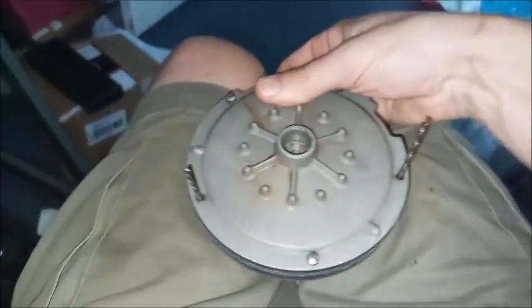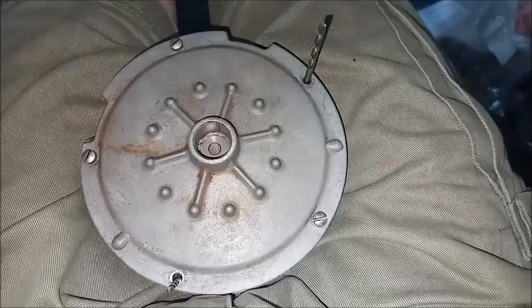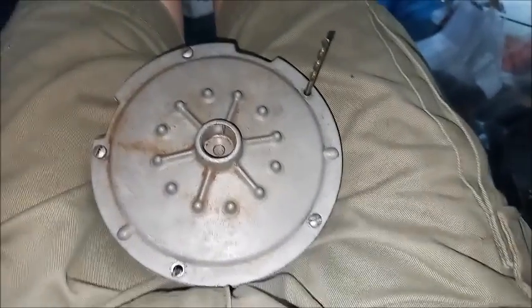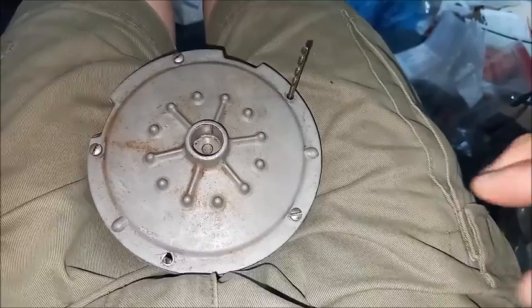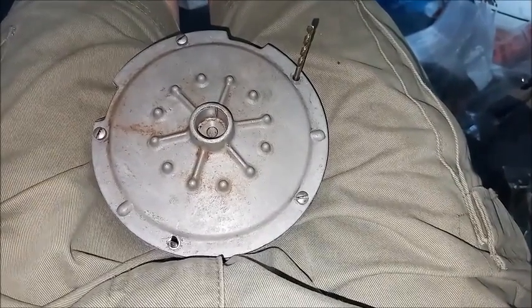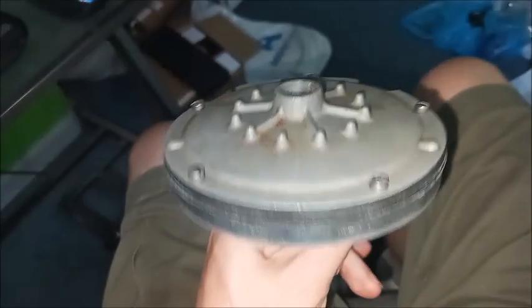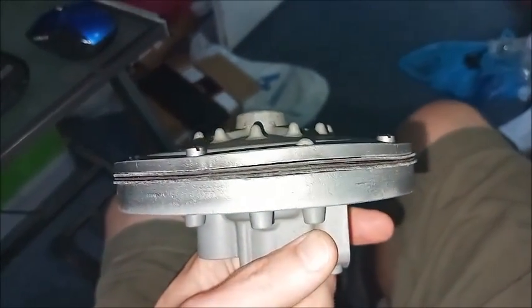So now for the remaining three, I did the compensating pin first because it's the smallest and the hole might be off center more than the others, so I wanted it done first because it'd be easier to adjust. Once they're all started, just tighten them down. You can see the warpage here.